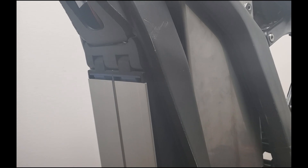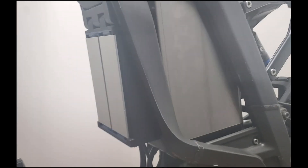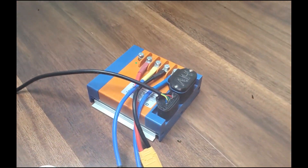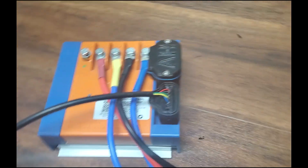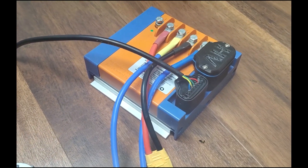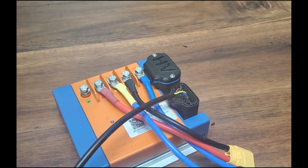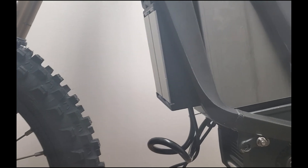I've also hinged it at the top here, which is to take some of the stress off of the 3D printed brackets, because over time you can get some stress cracking in those. So by having a hinge, that's helped a bit with that. Another reason I can get it that close is because the harness wiring uses my own design for the plugs — one with the phase wiring — and they eject the wires across the face of the back rather than sticking out, which means I don't have to move the controller to make room for that wiring.